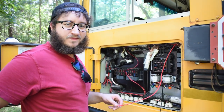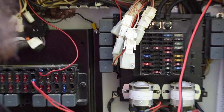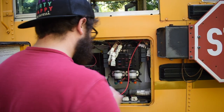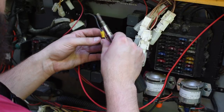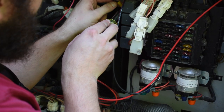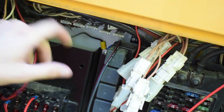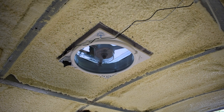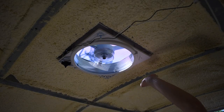This is not at all permanent — don't judge. We're just running the hot wire to the fuse block and grounding it to give the fan power. It's supposed to have a five amp fuse on it but we don't have any spare. I shared a ground with whatever this is — I have no idea what that is, something that was added on the bus. It's time! That's a small fan but it's pulling pretty hard.